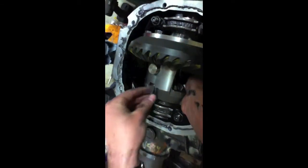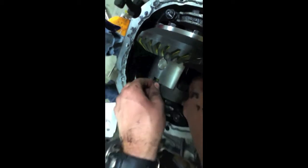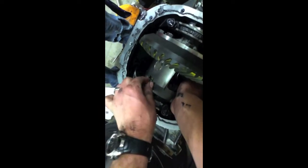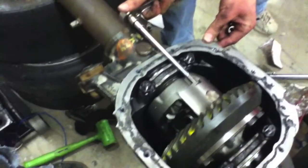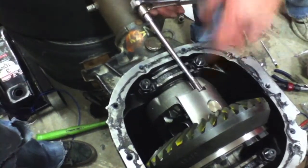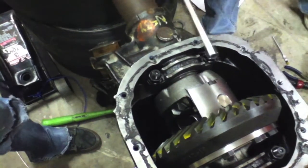We're going to line that up and start to put our screw in, and there we go — it's in place. Now we're just going to tighten this down. This is very important because it's sometimes called a grenade pin, because without this it will grenade your entire traction lock. We're just tightening this down with an 8mm socket, getting it good and snug. There was a little bit of Loctite on here because it was a new bolt, so I'd recommend if it's a used one to put some Loctite on there so that this doesn't come out.